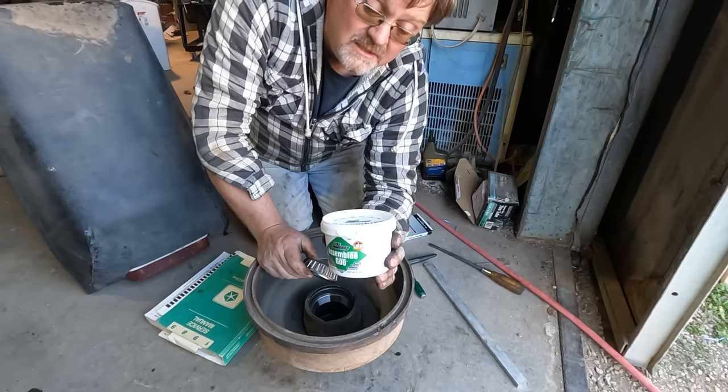These shocks are still good - put them on about a year ago. Let me show you what the old shocks look like: these are the shocks that have been on here since the last century, and they don't really work. Now that I've figured out the technique on the first side, the second side is going a lot smoother. I put one all the way down, left the other way up, used chain-type vise grips to squeeze them together so I could get the plate on and have the nuts in place. A little tapping, a little wiggling. Apparently you learn things as you go.